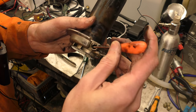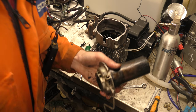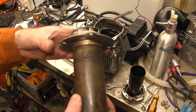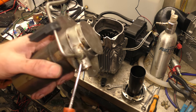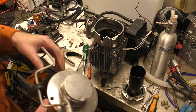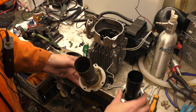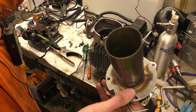Getting this mesh out may be a challenge. What you should do is have a spare mesh - and I do have one. Where's my other burn chamber? I've lost a burn chamber. I should just see if I can swap it for the other burn chamber. After a little bit of searching I found my nearly brand new one - used once or twice for experiments but it's all clean. The diesel flame front hole is nice and clear. We'll rebuild with this one - and it is exactly the same size; the holes match. So we'll rebuild with this, clean the exhaust out, and see if it fires up. I should empty the brake cleaner out of it first, because that would be interesting.